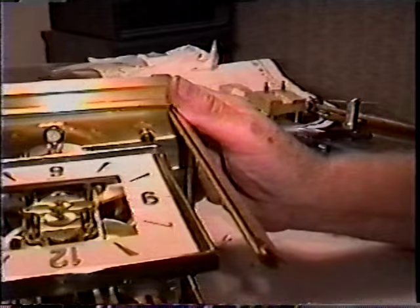It has screwed in screws on the side, and there's six of them. And it also has the timing washers. The washer goes onto the screw, and then the screw goes into the plate. You pull one on one side and one on the opposite side. And they also come in different thicknesses. And this is the frame layout of the 540, which is a little different than the 528 and 526.